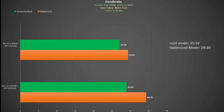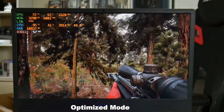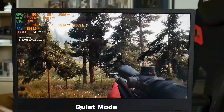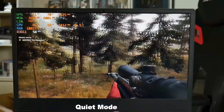I don't recommend using cool mode for anything — it basically slows everything down. In CPU workloads like Handbrake it slows the CPU by 20%, pulling 44 watts versus 86 watts in optimized or ultra performance modes, and in gaming you'll get frame rates in the teens. Optimized mode doesn't do much in the way of affecting speeds or reducing temperatures. I used ultra performance mode for all my testing but also did some tests using quiet mode.